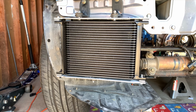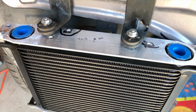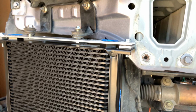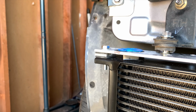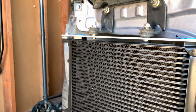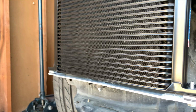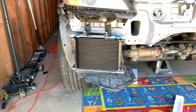Before I do a little movie magic, I gotta say, mounting these oil coolers was definitely a pain in the ass to get right. But after completing the install, you can see everything came out great. Also, one of my subscribers asked if this would work for the RX-8 with a stock Renesis motor. Yes, this would, and Franklin Engineering does make an external feed adapter for the Renesis motor as well. You might have to find another mount for your external filter adapter though if you don't want to cut out the center brace in the engine bay.